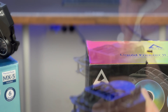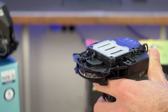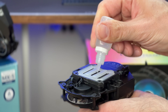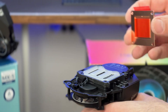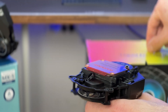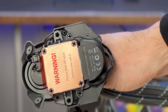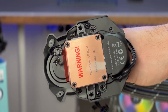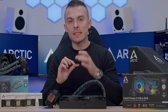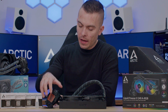Use the MX cleaner wipe to clean up any gunk buildup if present. Then carefully place the new gasket — orientation matters. You can top up the liquid using what's included in the service kit. The copper plate has two cutouts of different sizes; the smaller cutout needs to go on top of the little indent so orientation is correct and you get proper flow through the copper and fins for optimal cooling.